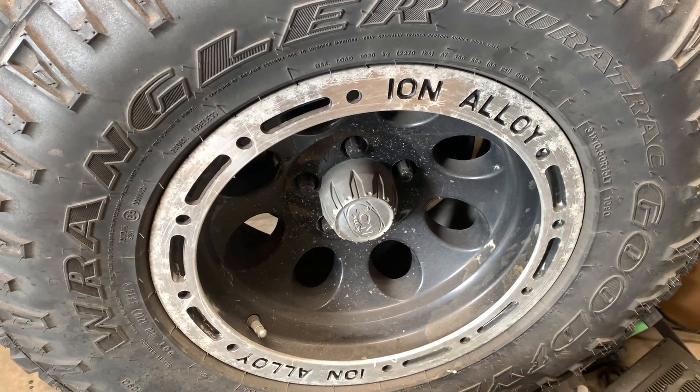That sounds like a great idea — who wants to fight with that? But I'm gonna explain to you right now what the issue is. We're gonna look at three things that are all related. You've probably heard horror stories where someone bought wheel spacers, put them on with an impact gun, and the tire goes flying off. We're gonna look at bolt tension — just because you torqued your wheels to the correct specs does not mean you have the clamping force required.